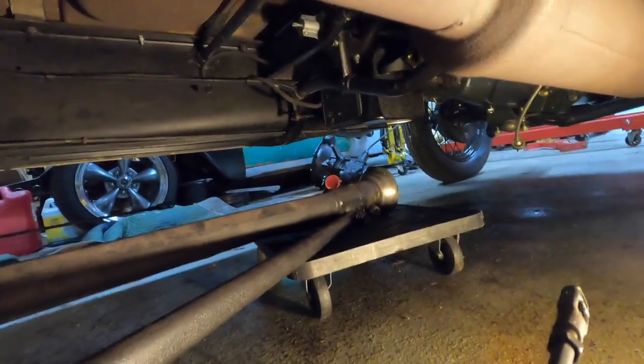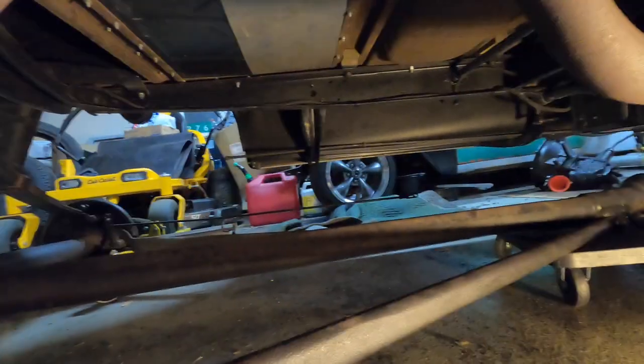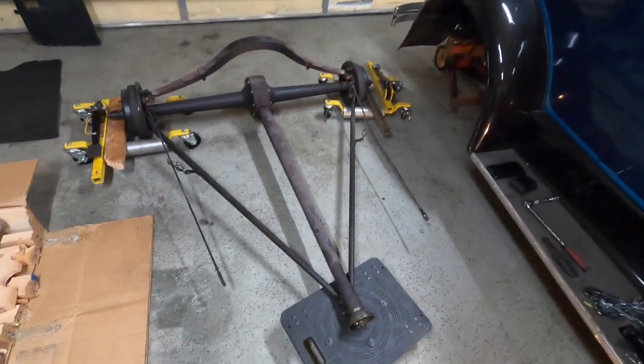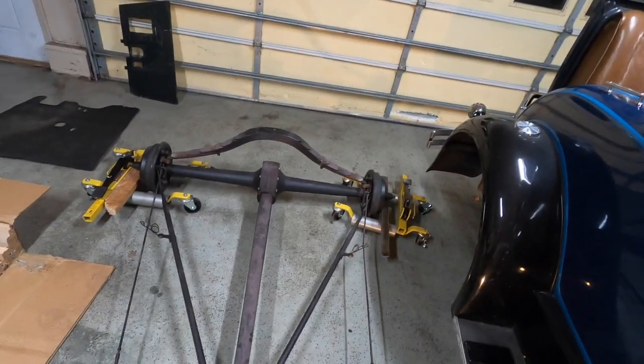This is where you eventually want to end up: I have the front of the torque tube resting on a little moving dolly, and the rear resting on my Harbor Freight dollies — everything can slide. I did take off the longer brake rods. Unfortunately I didn't have my taller jack stands, so I have to use the bumper jack the entire time and take the entire axle out through the side of the car. Here we have it — the axle is finally removed.